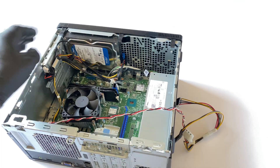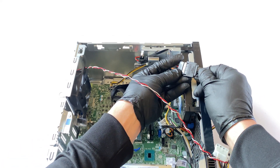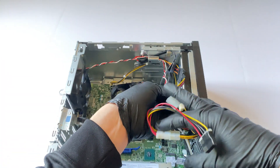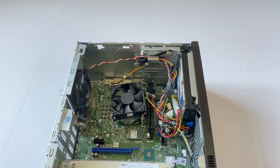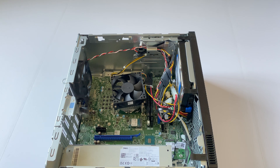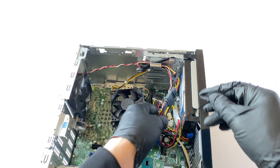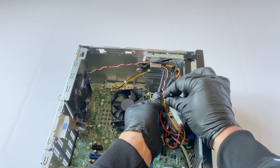That's installed. I'm going to plug it in directly and use wire ties to secure the cable. Now, this system has a 200-watt power supply, which is pretty low. If you want to install a GTX 1650 or GTX 1050 Ti, you have to upgrade the power supply. But you can use a GT 1030 or RX 550 with this supply — and when you install a video card, you must install the rear system fan because it's very critical.